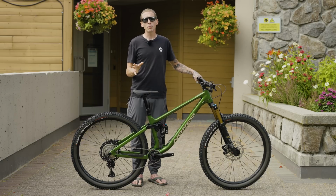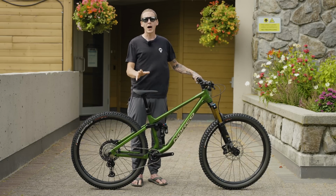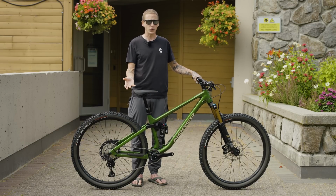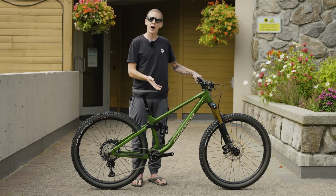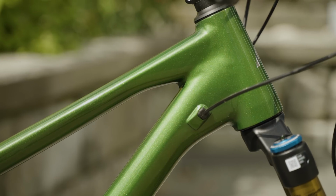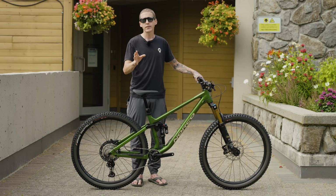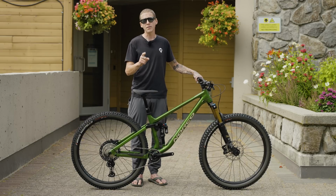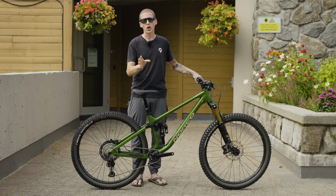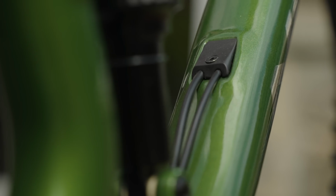The other thing we're going to talk about before we leave, geometry. That's much more important than suspension. Norco uses something called ride-aligned geometry on their higher-end, more expensive bikes, but now they're also using it on the Fluid. So you could get ride-aligned starting at $2,700 American. And what is it? On the Fluid, that gives you a 65-degree head angle and the appropriate reach and all of the other numbers, but it also gives you size-specific rear center lengths and seat tube angles. So each size adjusts accordingly. So that means that if you're super tall or super short, the bike should still feel normal.